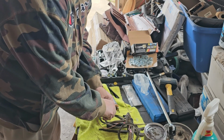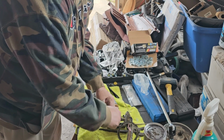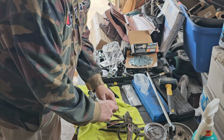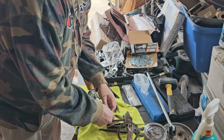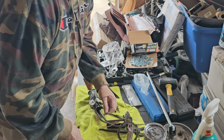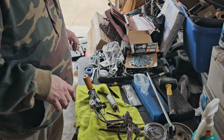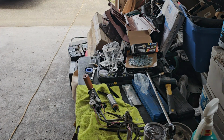Lastly, I used solder connectors to connect the wires. Originally, I just used some metal spade connectors, and I know in a tank it's fine, but I just felt more comfortable having the red wire, the hot wire, with plastic around it. I made sure to check the website, and the plastic I used won't corrode in gasoline. I just didn't want it to somehow shake loose and hit the ground and boom, which I don't even know if that could happen, but still it made me feel more comfortable, so I went ahead and did it.